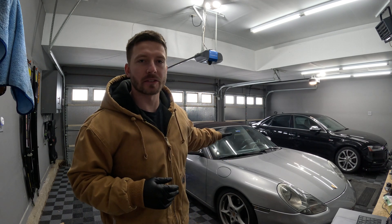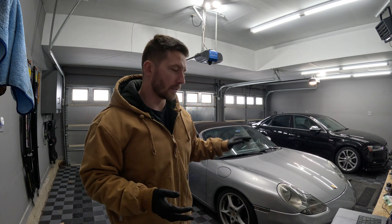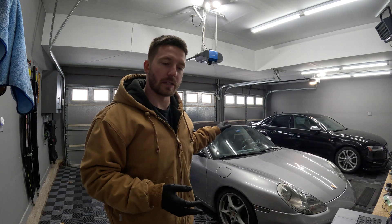What's going on guys? I got the 986 behind me and I just went for a long test drive after replacing the IMS bearing and the second gear components. So if you've been following the channel you might have seen those videos. This was the first long test drive I've done after doing those and unfortunately the check engine light came on. I'm worried I messed something up with the timing — I had to lock the timing, take out the cam tensioners, and replace the IMS itself.